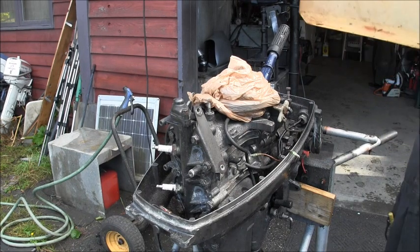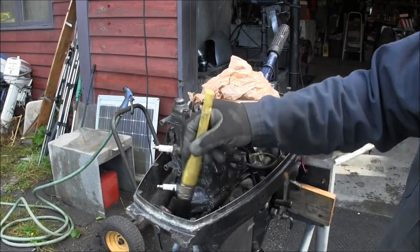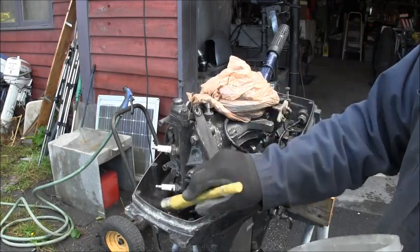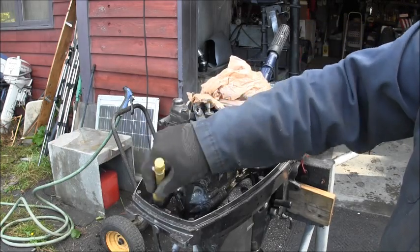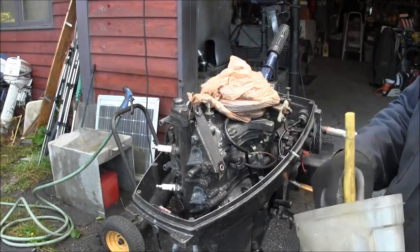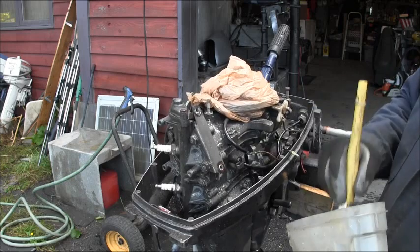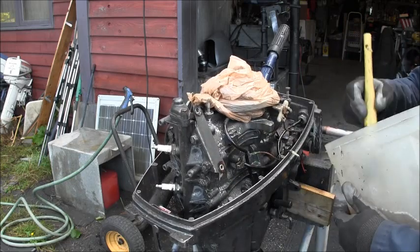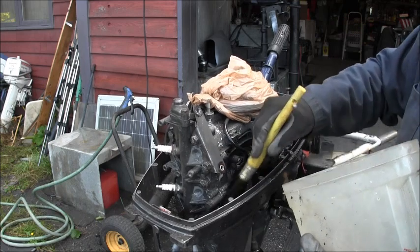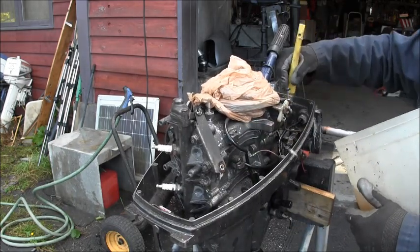What I got right here — see all the water in the bottom of it? It's just some old yucky gasoline, because this thing has a lot of grease and just everything. On this guy it's so bad I'm going to give it a little bit of the old gas treatment and cover it up with a plastic bag up under the flywheel stuff. I've got a rag sprayed with Tri-Flow in my carb intake hole, and I put the plugs back in. This thing has just got so much nasty — I want to get this old gas and loosen this stuff up. It's been sitting in this engine for probably 20-plus years.